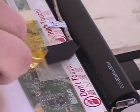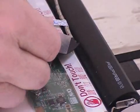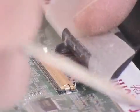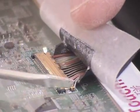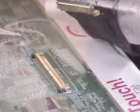Next, look at the back of the screen and remove the tape that covers the connector on the back of the screen. It's a very small connector with many many pins. Then take a screwdriver and unplug the connector from the screen.